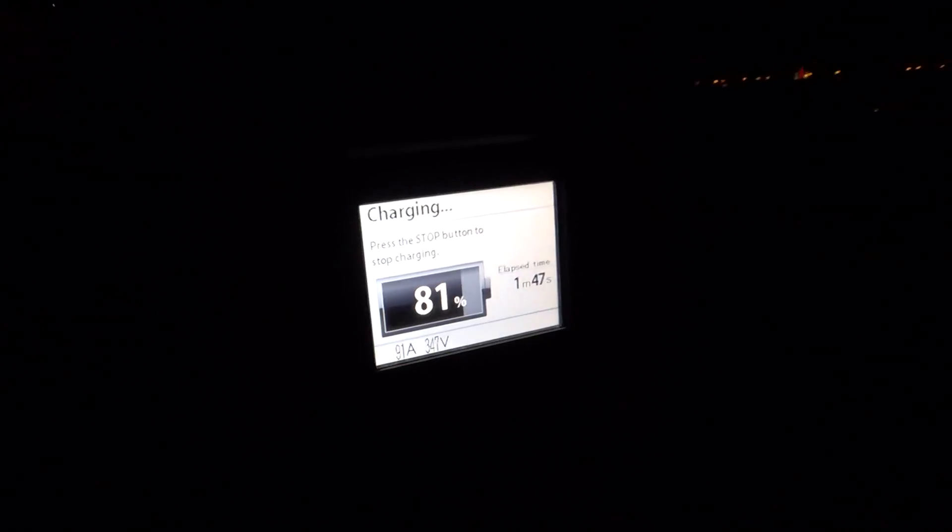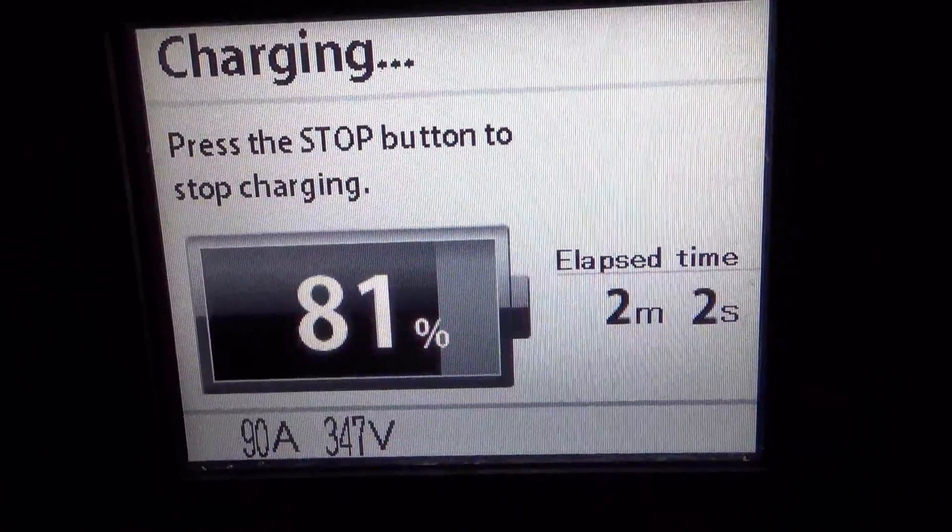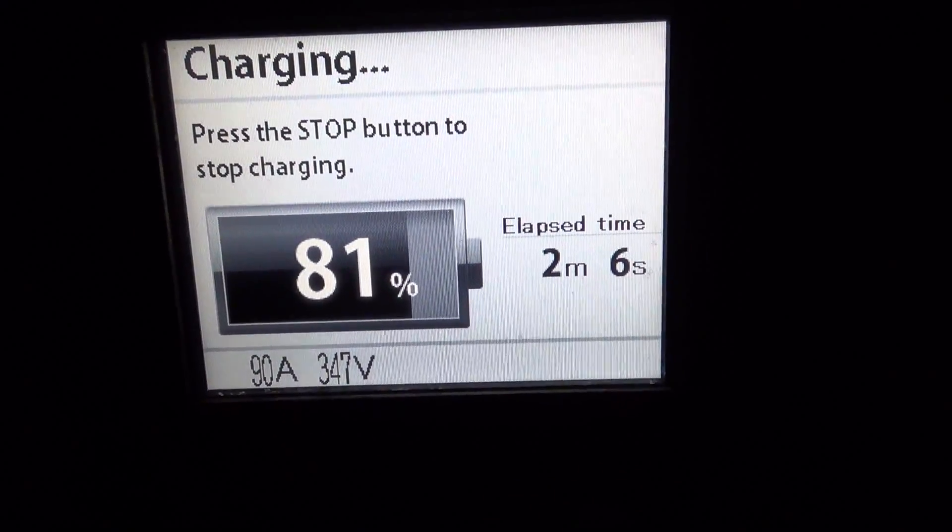I want to show a reason why Tesla took so long to make this adapter — I think it was almost two years, a year and a half late coming out. A 60 kilowatt Model S, which is what I have, has a fully charged battery at 353 volts. An 85 kilowatt Model S with a fully charged battery is probably about 404 to 405 volts, roughly, plus or minus a volt or two.